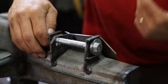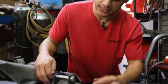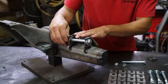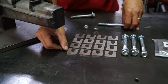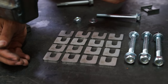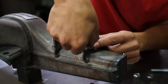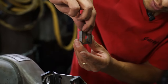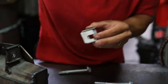What the Shim Kit does is achieve the same thing, except it prevents issues when you're road racing or spec racing — if you're hitting things, the eccentric hardware can get knocked out of alignment. So in order to avoid that, you use the Shim Kit. The shims are all marked in increments from zero to three, engraved in the corner, and these basically stand for millimeter adjustments. Zero being either the very bottom of the hole, or if you flip it, the very top — or for a toe bracket, very far forward or very far back. It's your zero adjustment — meaning bottomed out in one direction or the other.